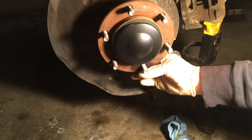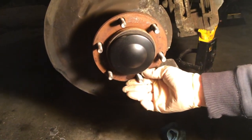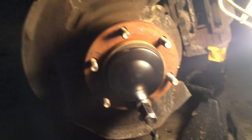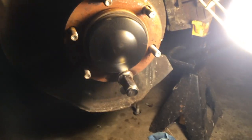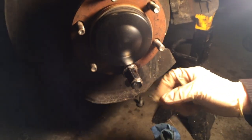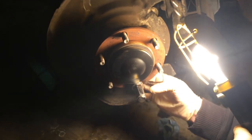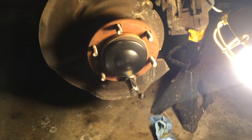Put that right in there and I'm going to use some of the lugs to pull that in. To get the new lug tight, I put an old longer lug on that I had from a prior Toyota and torqued it on with this electric impact. Around the back it's completely flush so it is seated, and now I'm ready to go ahead and remove that and reinstall everything.